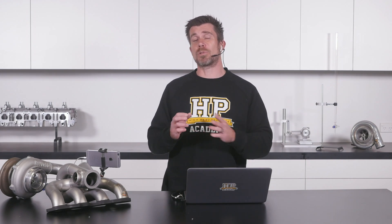Another thing I wanted to talk about — this has been mentioned a couple of times in our webinars and a member emailed in asking for more clarity — is the concept of exhaust manifold back pressure. I've talked about this in our webinars on turbo dynamics and measuring turbo performance. For me it's one of the metrics I use when looking at turbocharger sizing — how well I've sized the turbocharger to suit a particular engine. There's no magic number every turbo installation should have. We tend to choose a turbocharger that provides less back pressure if we're prepared to give away some low RPM performance to gain high RPM performance — a perfect application being a drag car.